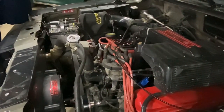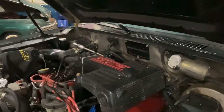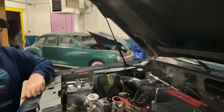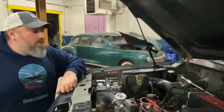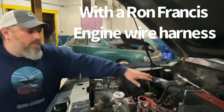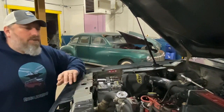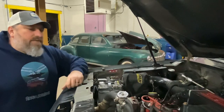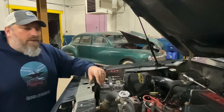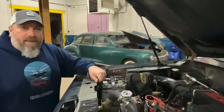And as far as the electronics go, I do not run it anymore on any kind of stock Ford computer. It runs on a MicroSquirt plug and play system from EFI Source. So the whole computer system is basically a speed density. There is no mass air meter on the inlet side. Speed density setup, it's all programmable. I'll show you on the inside. A 7-inch touch screen, a Raspberry Pi is where I can monitor everything in real time and do all my tuning for it. So it's a very cool setup, I think.